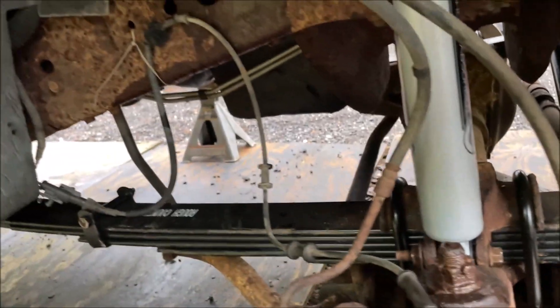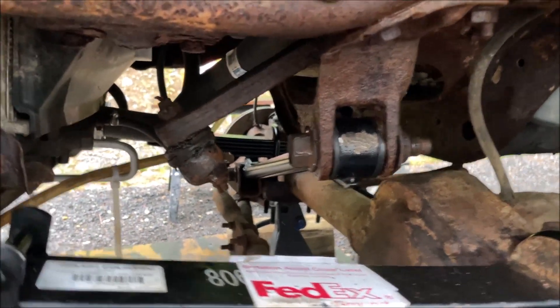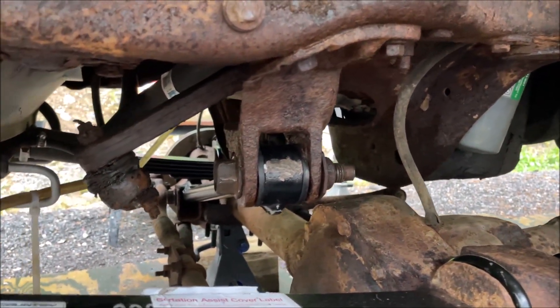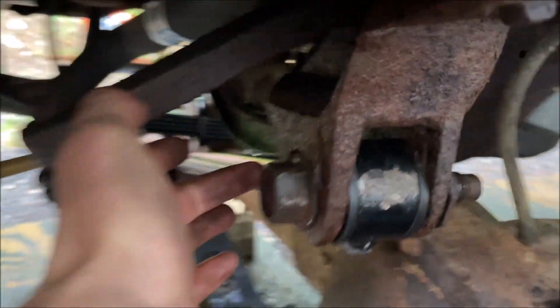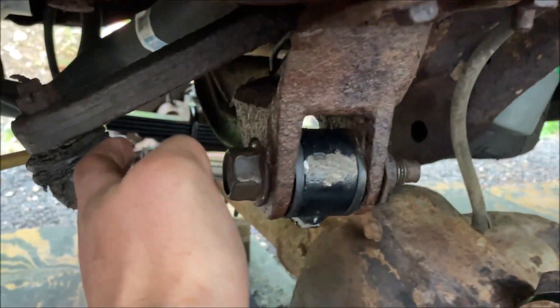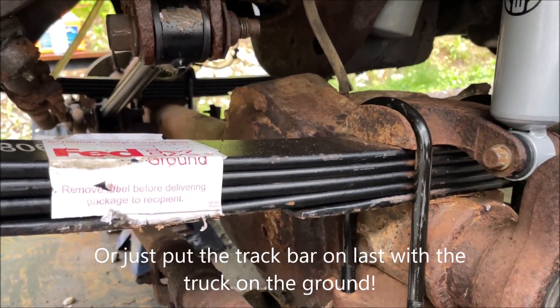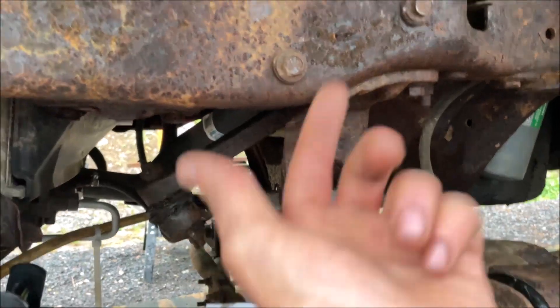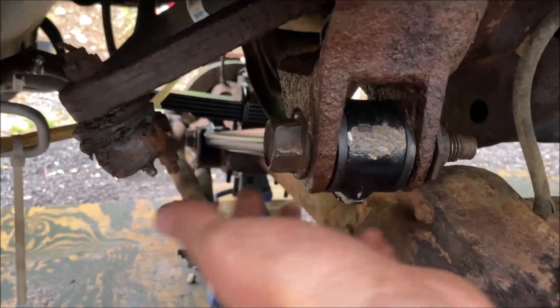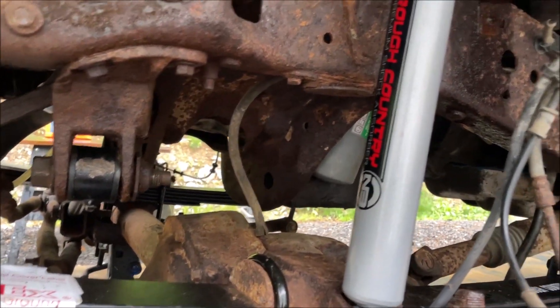Got it set up with the center pin, and after that it's pretty self-explanatory — get those u-bolts in and tighten them down. For the track bar, yes those are hammer marks — paint over it, not a big deal. It's kind of hard to move the track bar when it's in there because the bushings are so tight to the brackets. What I did: got the far-side bolt in, then noticed the hole was way back. I put the floor jack right there and jacked one side up as far as possible, watched the track bar, and got it close enough to put the bolt in. This kit doesn't include a drop track bar mount.